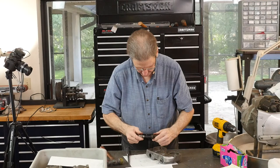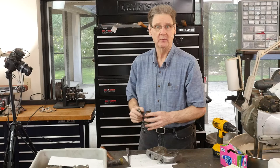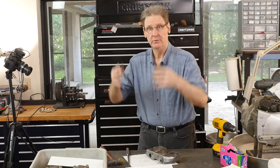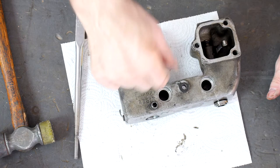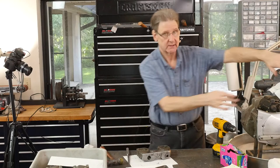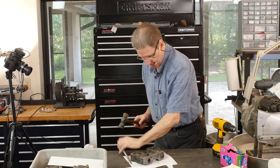You can now get an idea how worn this rocker shaft is — how shaky it is. Nice and tight, actually. It's a very low wear thing, and a lot of folks don't even measure it. But when this is loose, you get a lot of oil blowing out here — you lose oil pressure in the top, but it's more of a flow system. I used to pull these out, especially if I was going to sand, but when you put them back in you might pull the distance between where the oil tube goes. So I think I'm just going to leave that.